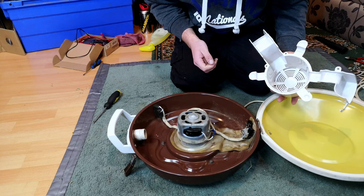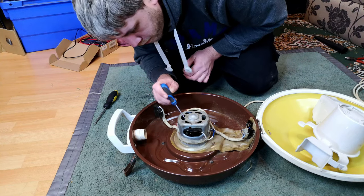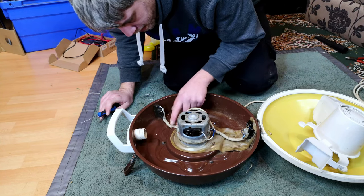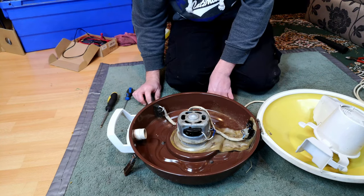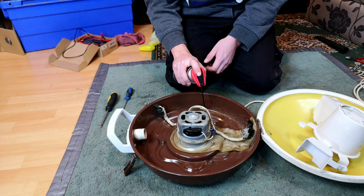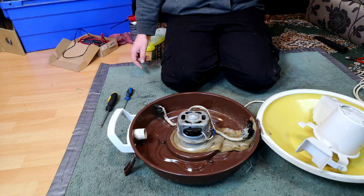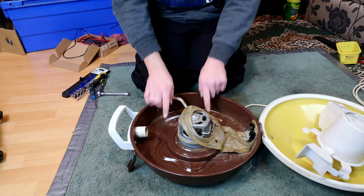There we go - 'do not lubricate', we won't do that! Now unplugged, we can take a screwdriver and check that the motor is barely turning at all. I think our problem is the motor for sure - there is something quite significantly wrong with it. Which means we have to take the motor out of a Hoover Celebrity. The first thing I'm going to do is lubricate these nuts which we're going to have to take off first. I'll take the wiring out, take some reference photos, get those nuts loosened because you do not want to snap these off.